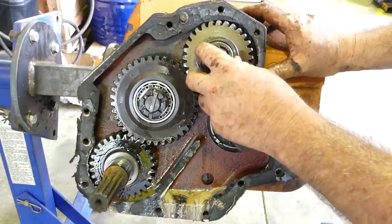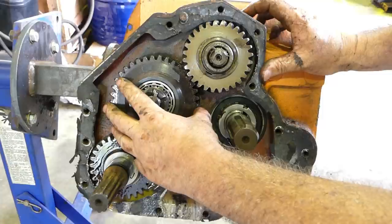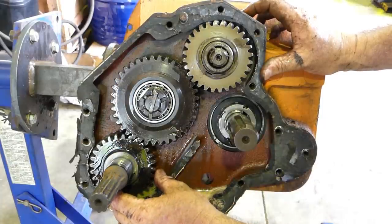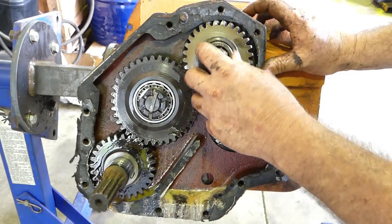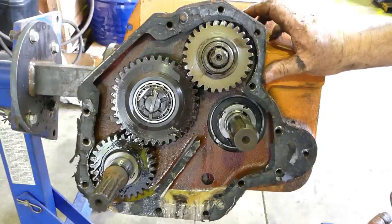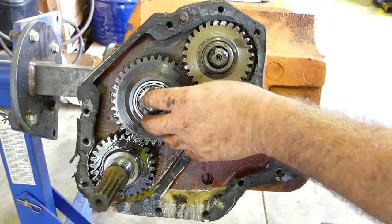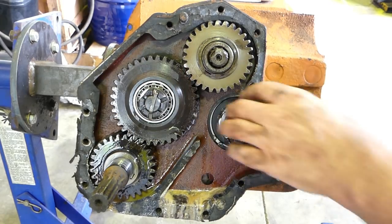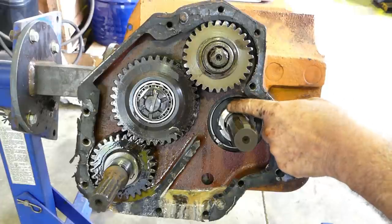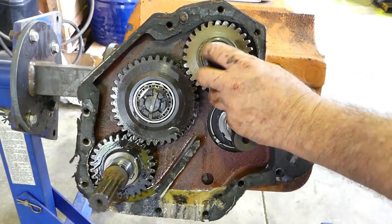What we should be able to do is remove this gear — we don't need it. We can remove this little drive train — we don't need it. They're helical gears but they'll just be running around doing nothing. When Paul and myself had a chat about doing this, we decided why put new bearings here when we don't need to — these tractors are never going to be PTO tractors ever again. This is the back of your reverse idler through here. It looks like this has had a bit of a bashing around, but we'll just slowly work on this bit.